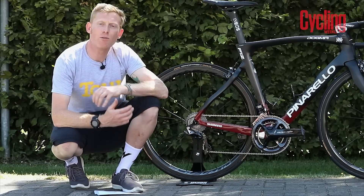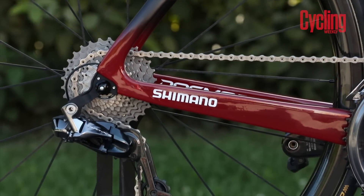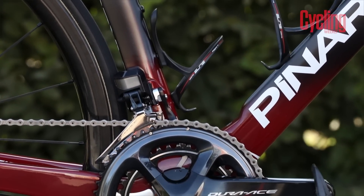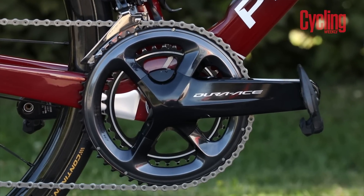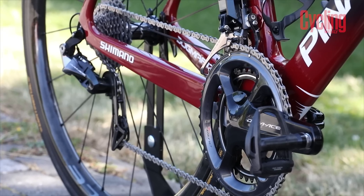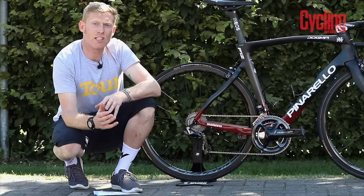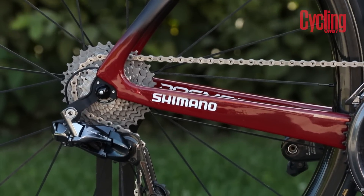Like the rest of his team, he's running Shimano Dura-Ace Di2 — the electronic version — which still uses wires, and he's running a standard chainset. Geraint has quite long legs, so he's running 175 millimeter cranks, whereas most people will be on 172.5s, and he's opted for a 53/39 chainset. These first couple of stages are going to be relatively rolling with potential bunch sprints — fast stages — so he's running an 11-28 cassette out the back.